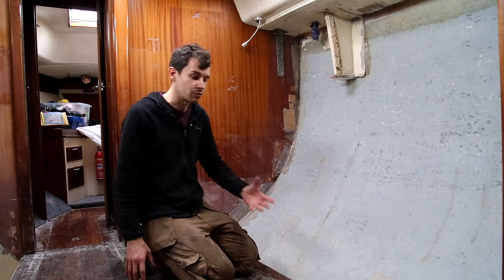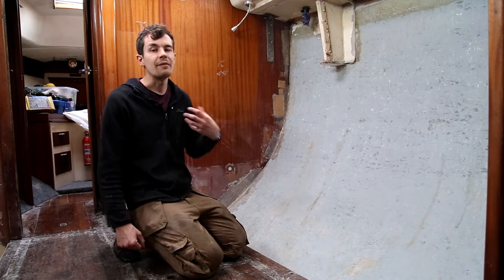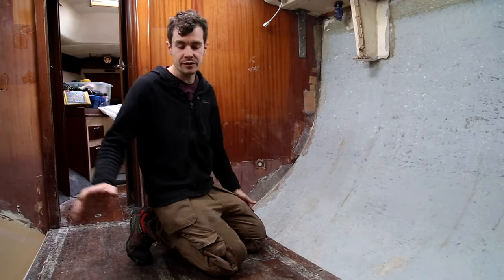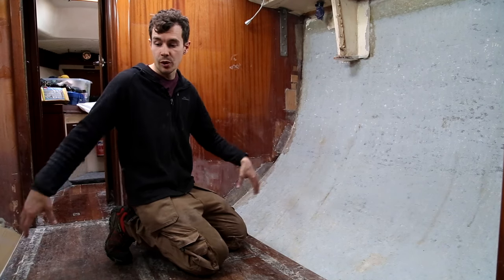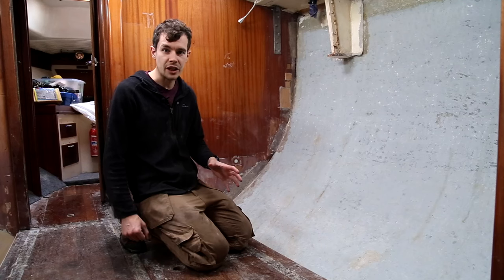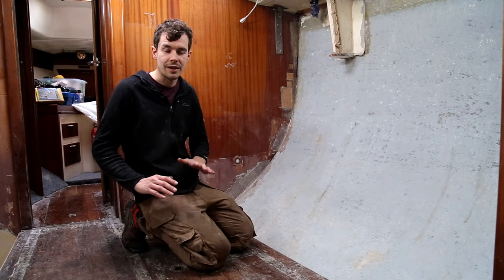Originally we really wanted to keep this flooring — it is really good quality and nice and thick. However, after working on it for quite a while, we've noticed it's degrading quite rapidly and for the longevity of this project, everything else is going to be new, so we might as well make the floor new as well. We're going to take up these panels and replace these two side supports. We'll replace the delaminated glass holding them in. Underneath these floorboards there is a big crack where the water tanks are going to live. We've put an initial epoxy layer in there and we're going to put some thickened epoxy on top, then paint everything from the sides of the hole all the way down onto the supports underneath to give it a nice fresh coat.